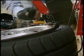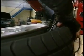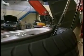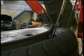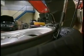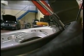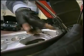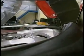One of the common problems with using a polymer mount head is people don't realize that the mount head has to be against the edge of the rim before demounting. When you use this HM lever, it allows you to be able to rotate counterclockwise before demounting, and if you notice, the mount head automatically comes to the face of the wheel. It protects the life of the mount head and also makes it easier to get the tire up on top of the tool before it's removed.